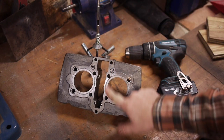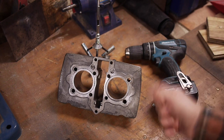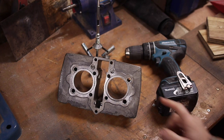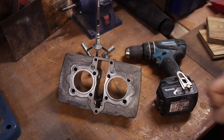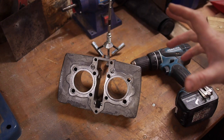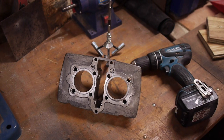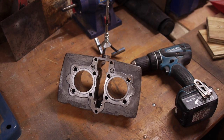I did think about working out the circumference of the cylinder and the length of the cylinder and exactly timing or getting some sort of rhythm in place for the in-out motion and the speed at which the drill is turning, but then I thought to myself it's not actually that hard - I think I'm overthinking things. I need to just get a feel for the speed that the drill's rotating and the speed that I need to be moving in and out to get that cross-hatching to work properly. So let's get it in the vice and have a go.